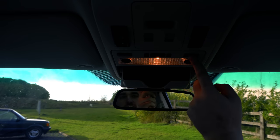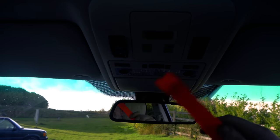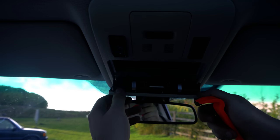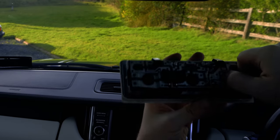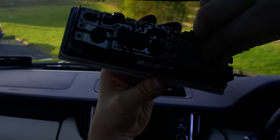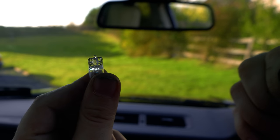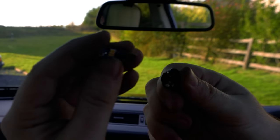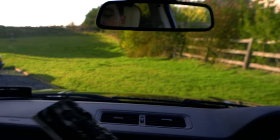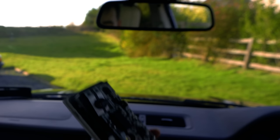We're going to start by accessing these guys up here just because it's annoying that they don't work. To get this unit down we're going to use our plastic trim tools — I'll put a link in the description — to prise it down without causing any damage. To replace these bulbs it's very easy: we've got these little twist-to-remove bulb holders that turn 90 degrees to release. Once out, we can pull the original incandescent bulb — one of these capless push-in types — then take our new LED replacement, pop it into the holder, and simply pop it back into the housing, screw it 90 degrees. Do that three times and we should have full LED lighting.